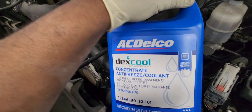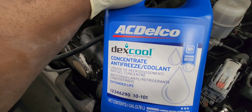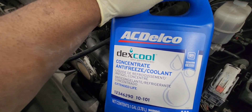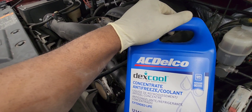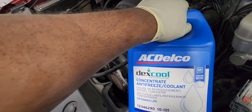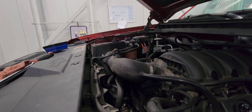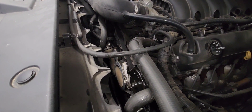For coolant, we need a 50/50 mix — half coolant, half water — to put in the cooling system and bleed it all the way. I'm mixing it right now. The coolant bottle is full; I'm about to start the vehicle, then put it on full heat.